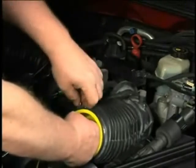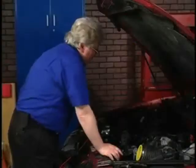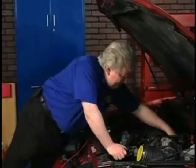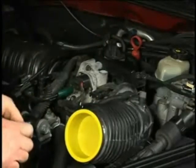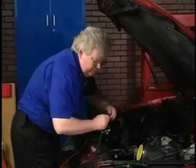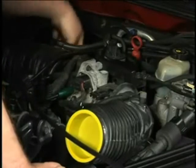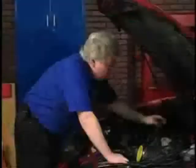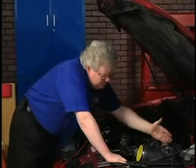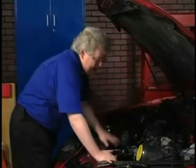Now I'm going to put some smoke in. If I don't have any leaks, I won't see any smoke come out. I'll grab a hose at the back of the intake manifold where we have our vacuum storage tank, pop that off, get a piece of rubber vacuum hose — 3/16ths — go on the end of our little cone from our smoke machine, and that's where we're going to insert smoke at the back of that intake. Even if there's a little opening with the throttle plate open a tiny bit, we should still block the smoke from getting out there, and then we look for anywhere else the smoke might get out.